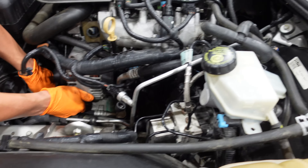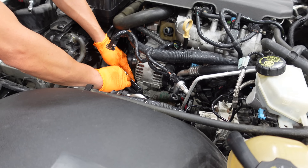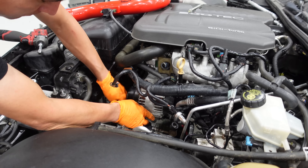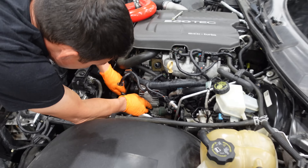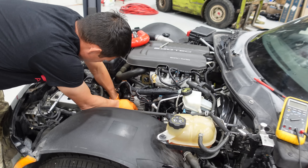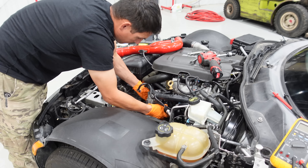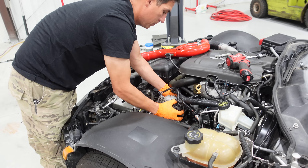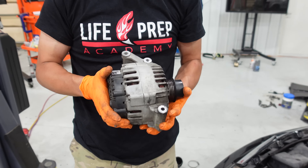I got the connector and I pulled the battery cable. There's enough of the battery cable, and Gabe had to pull off those three bolts. The alternator is ready to come out of this car. This is a little more difficult if the hood's in your way, but if it's not, we've done an easy job. Alternator coming out — so about a minute 30. It should be for three bolts.